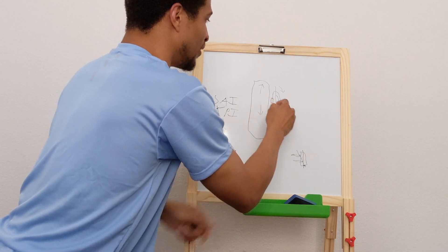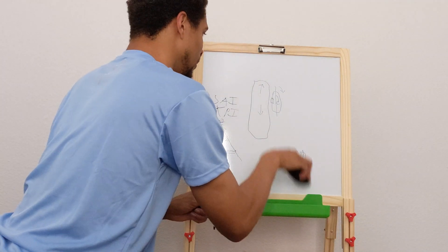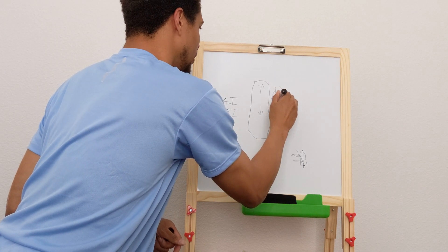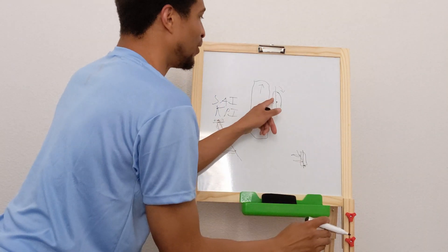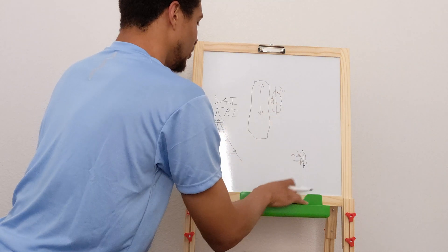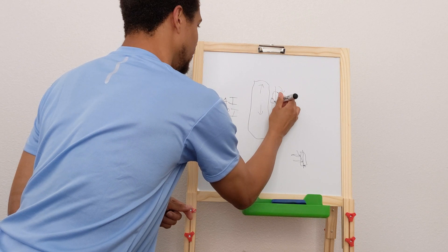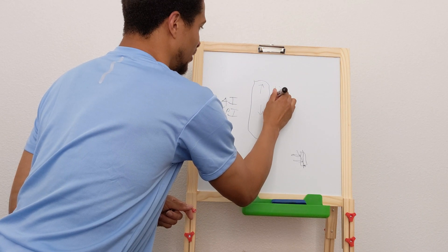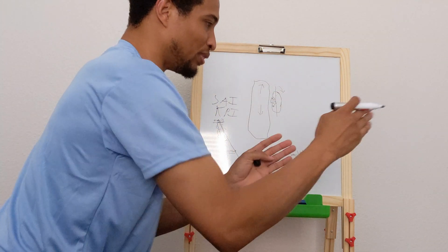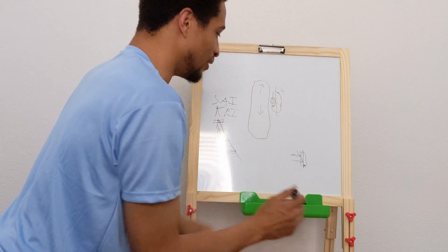Keep in mind that the further your scrub radius is from center, the tougher your steering is going to be. So you want very little of it — you want your scrub radius close to the center line, but not on it; just a little bit of negative scrub radius. If your scrub radius went positive, that force would be steering before the center line, making it more prone to turn under any acceleration or rotational force on that steering axis.